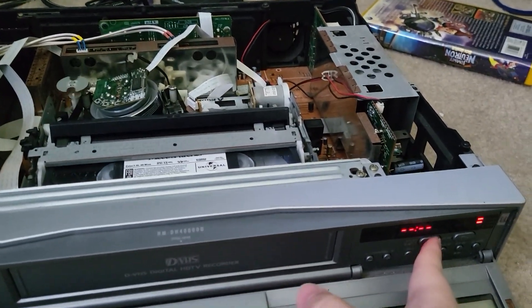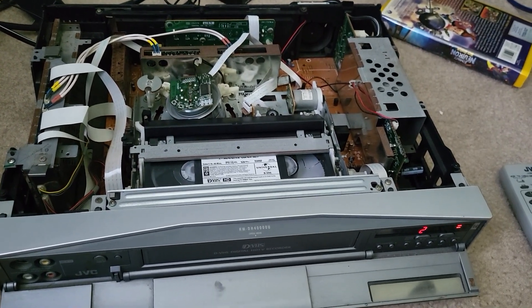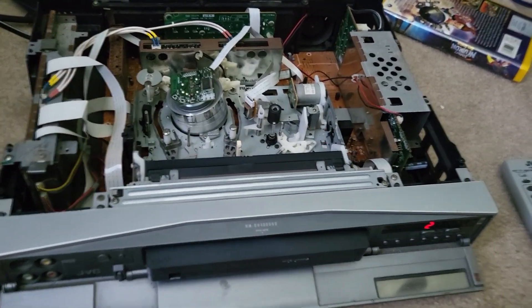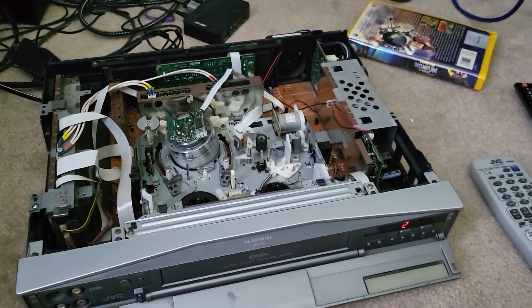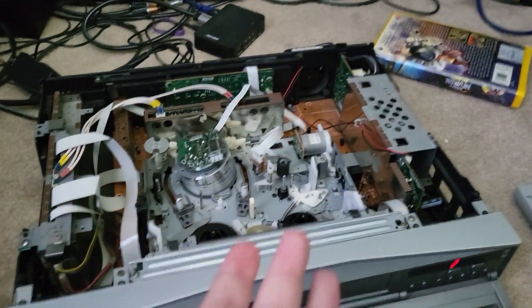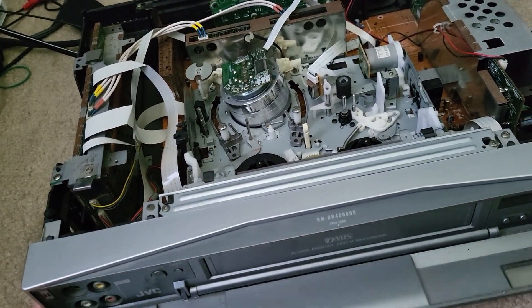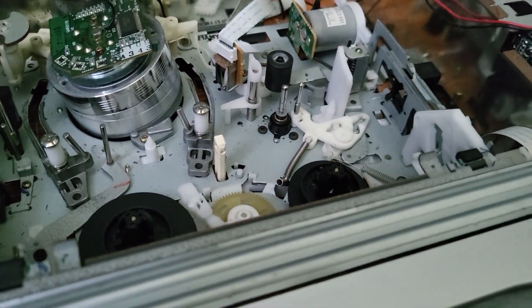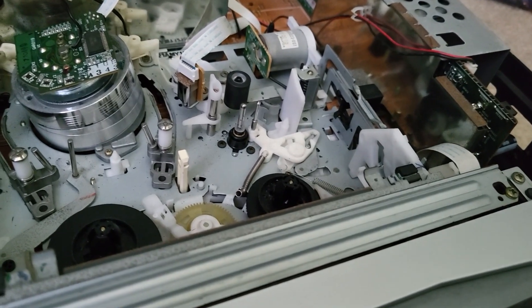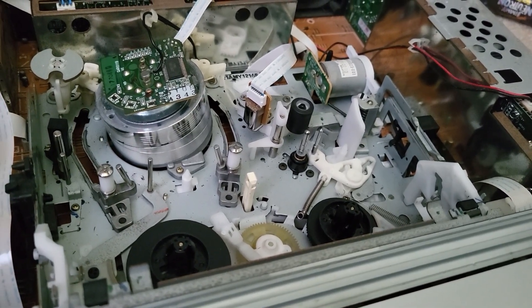Why I had this unit out to begin with: I was testing and playing tapes, making sure it was still working right. One of the tapes I was having a difficult time playing was the Ninth Gate, and there was something wrong with the very beginning — it ended up eating that tape. So I panicked, took this apart, gave it a really good cleaning. As you see, that capstan is definitely dirty — I was scrubbing it with isopropyl alcohol, and I think I got as much dirt as I could conceivably get off it.